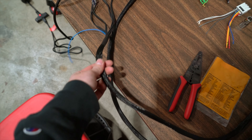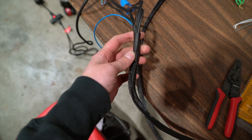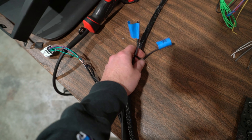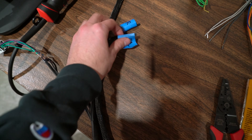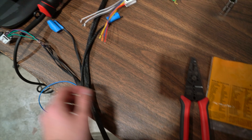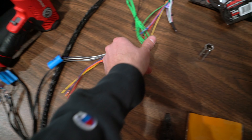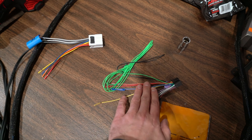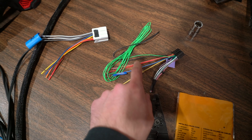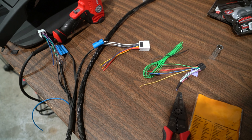I ended up having to pull the cover completely off to run the blue wire through, but got everything back together — heat shrink on both sides, blue wire coming through, and got these connected again. Now I need to get the front left and front right speaker wires attached to this harness. On the 350Z there are two different harnesses that plug in for the speakers, so we're going to get our speaker wires connected to those four wires and then tie in some of the other wires from the harness that goes to the stereo — illumination and some other stuff. A little more solderless soldering.